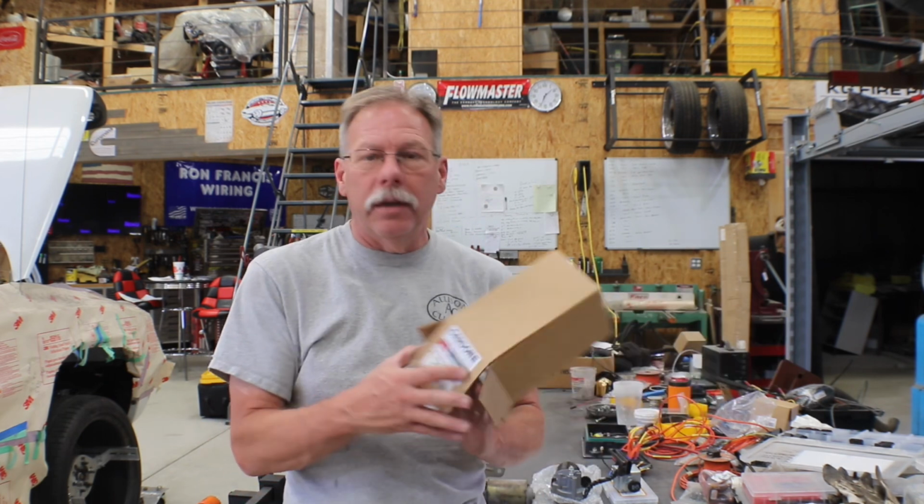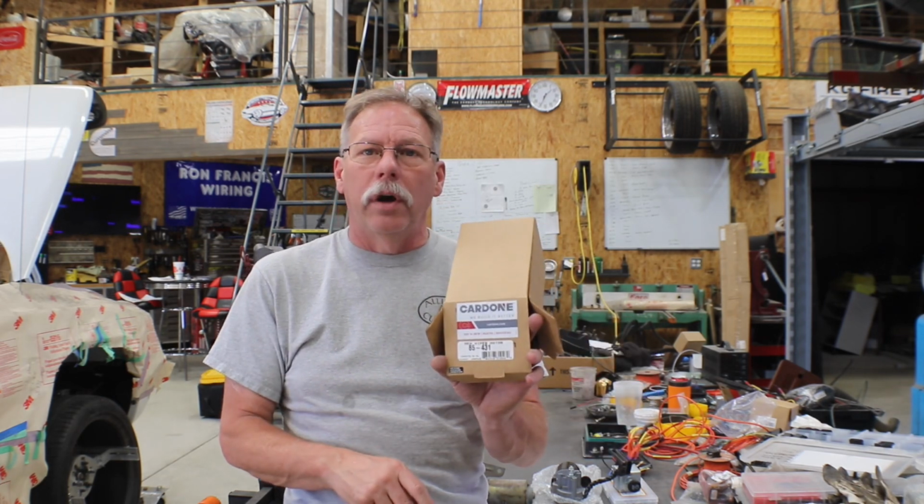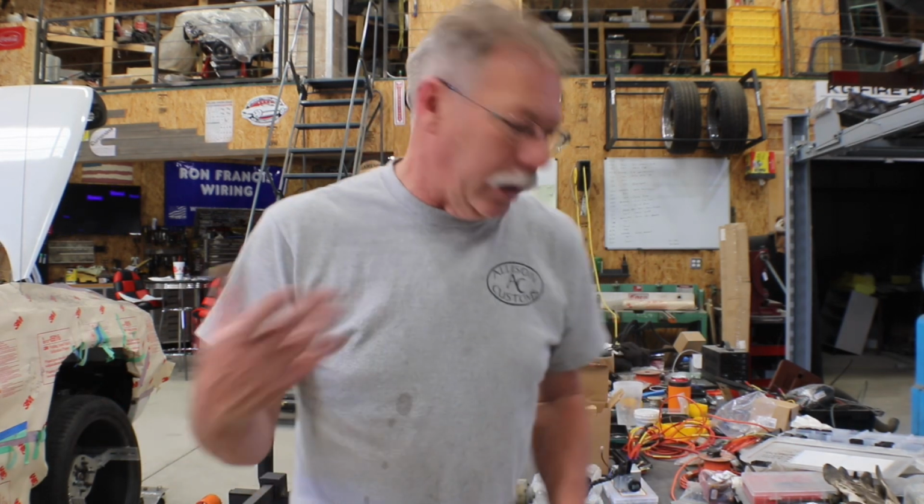The plan here is we are going to make use of a much more modern motor that is readily available at, say, NAPA Auto, O'Reilly's, AutoZone, RockAuto online. I got mine off of Amazon once I'd found the part number I wanted to use. And that part number for me is a Cardone part, 85431. There is also a NAPA part number 49-900, that would get you the part, and it was available.